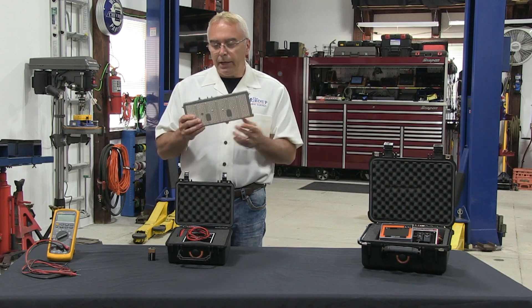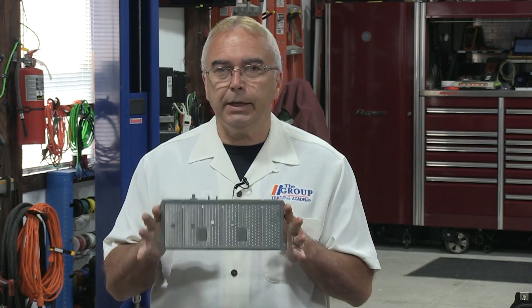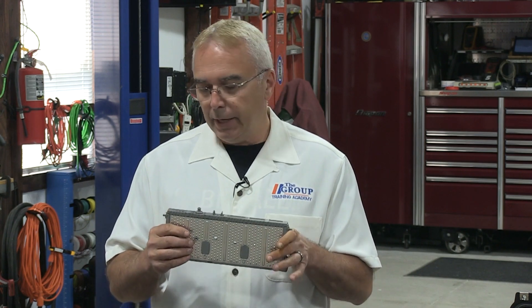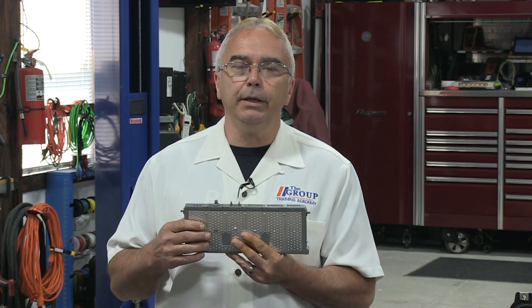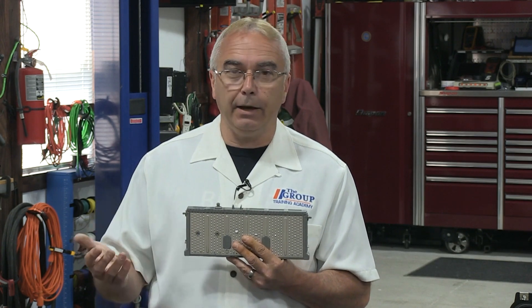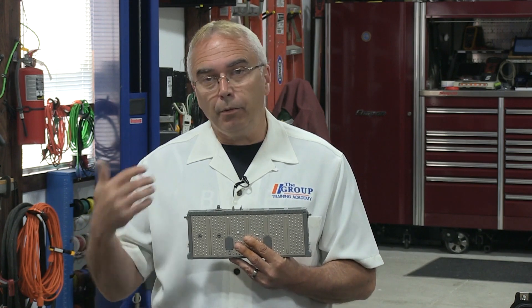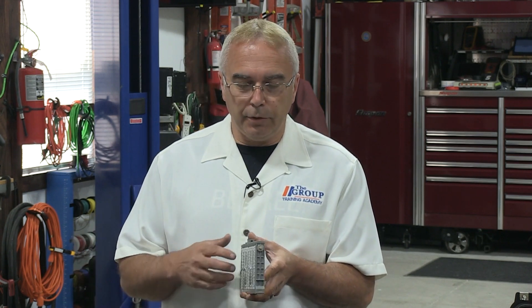This one here is from a Toyota Prius. They're supposed to be about 7.5 volts. Now this is a bad cell, but for demonstration purposes it gets the point across on how to use this tool. Even if it was fully charged at 7.5 volts, it would definitely not pass a valid test once the scan tool starts interfacing with the computer. It would always have a weak battery block and keep throwing trouble codes since it's a Toyota.